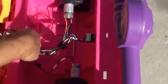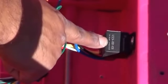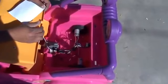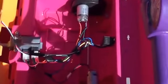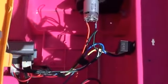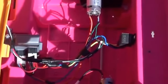What I did is I installed it. This is basically installed here, and you also have to get yourself a relay — which is a 12 volt 30 amp relay — you also have to buy that, it doesn't come with it. You pop this off right here, and that's where you've got the hot wiring harness, and you connect it all according to the diagram. One of the problems that came about when I put it on is that it turns out you can't turn it off and on, because I think because of the motors. I don't know if it does anything to the remote, but you only get about 10 to 15 feet of range when it's 18 volt, and about 30 to 50 feet when it's on 12 volts.